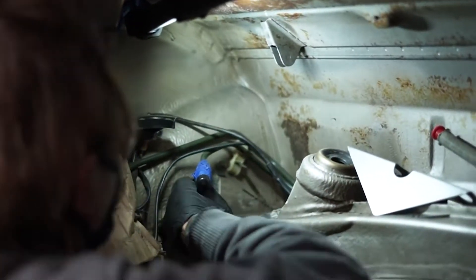With the panels test fit, you'll want to remove all undercoating, paint, galvanizing, and corrosion within and slightly beyond the work area. Inspect the area for the extent of damage, if any. If there is damage, cracks should be continuously welded and ground flat to ensure a flush fit between the original metal and the reinforcement panel.